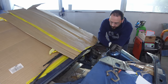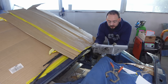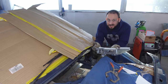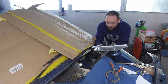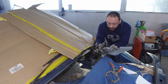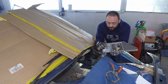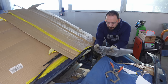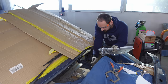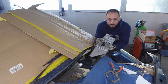Whew, that was a lot of fabrication. But we've ended up with a really nice piece of this bulkhead. Now, I don't know if this is going to be 100% like it should be, but it's pretty close. Considering what was left, I've managed to copy the shapes as best I can. There's an extra reinforcing plate that sinks into the metal on the inside, which also steps out to get the brake booster bar in situ. This has all been fabricated.